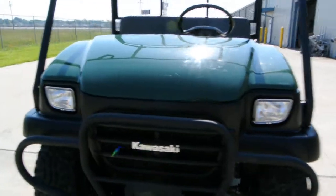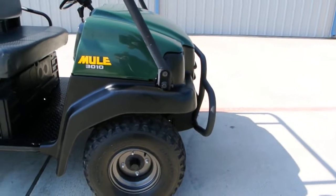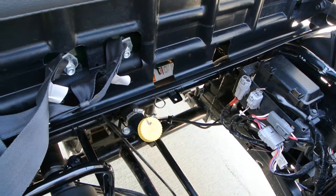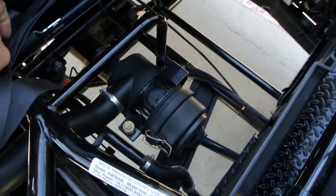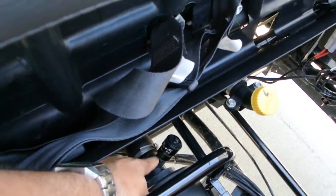I always like the 3010s because they have this nice little grill guard on the front — you can mount a winch in there. The tires are in real good shape on this. These are the original tires: 23-inch tall Dunlop tires. Here's your fuel tank. It does have seat belts. Oil fill and you can check the engine oil right here, so if you had stuff in the bed you don't have to tilt the bed to check the engine oil — you can check it right here underneath the seat. Over there you've got some fuses and relays. Here's the air filter for the motor. You can see this pipe connects to this tube — it goes up to the snorkel we talked about. There's your filter for your motor, and these have a little restriction gauge that tells you when that filter has too much restriction and it's time to be serviced.